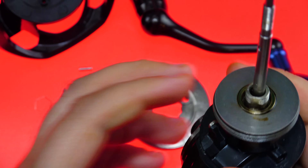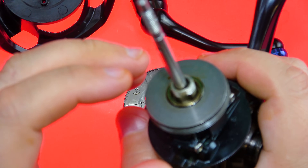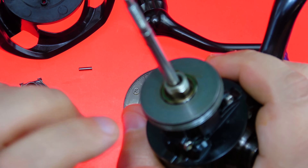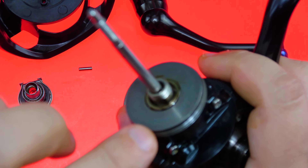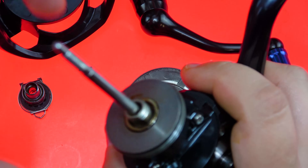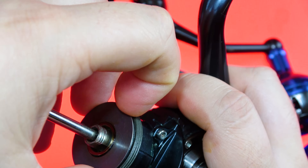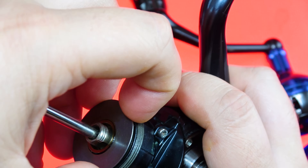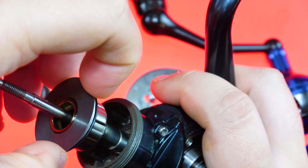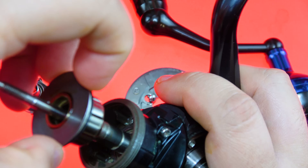It's at this point you're now staring at what makes up the MagSeal unit. Now, what you want to do if you don't have this stuff lying around is, with three fingers go up and over the main shaft, and with your fingernails lift up one side of that magnetic washer. And once you get it as so, you can lift it out.